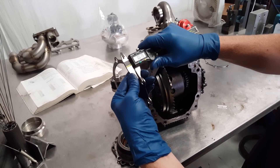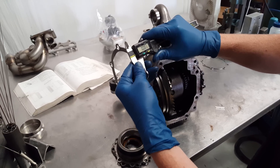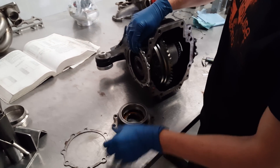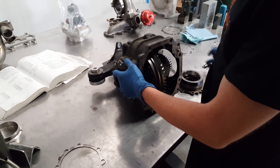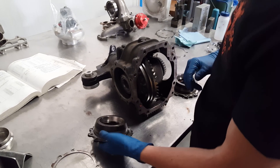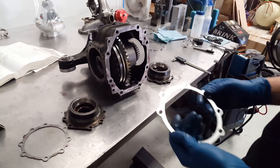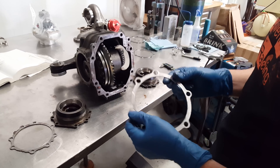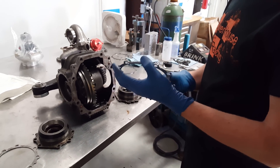I need to go a little bit further on this — I'll probably peel away one or two more layers before I go in and check my measurement. But that's basically it. This will go in here, we get rid of the old shim, this lines up on there, you reset it, do the same on the other side. You'll have your measurements beforehand, put that side on, go back and double-check your backlash and preload according to the manual, and that's basically it. We think it's a pretty cool product and a great solution for all the people who are needing it. We appreciate you watching our video — hopefully you guys can make good use of this.